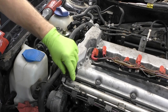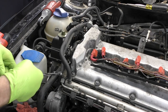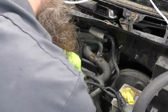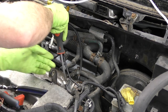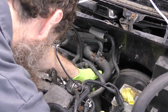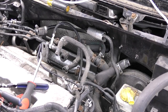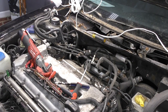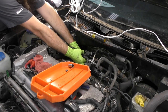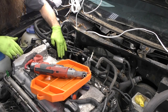Fuel lines — I'm going to take them off at the fuel rail and just leave them in the car, one less thing to worry about. That smells like old fuel. Next we've got to deal with this rat's nest going on back here. A lot of this stuff on this side, this metal bracket and the stuff attached to it, that's going to stay in the car. I only need to remove the stuff still attached to the engine, which is one coolant hose here and one coolant hose at the coolant flange. We also need to unbolt the bracket here and over here. So now all this whole mess can stay in the car — we don't have to deal with it.